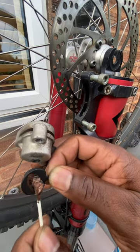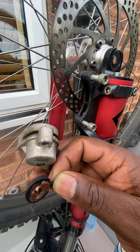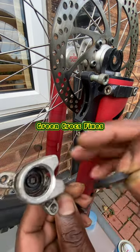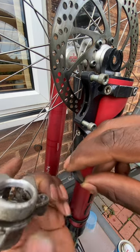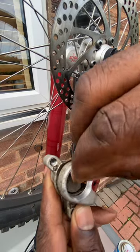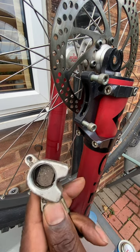It's just a matter of fitting the new brake pads. I'm going to put a bit of copper slip on the back so it doesn't squeal, and it's just a matter of popping the new brake pads and brake linings in. It just slots in like so - just wiggle that around so it settles into the button.